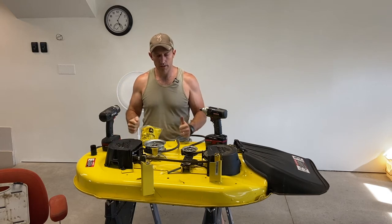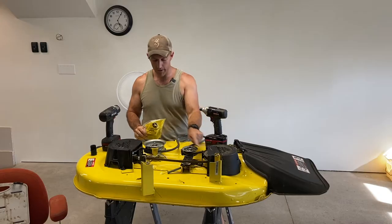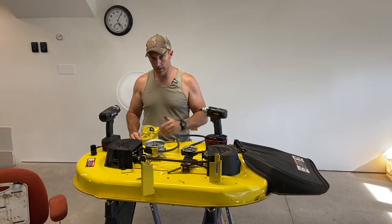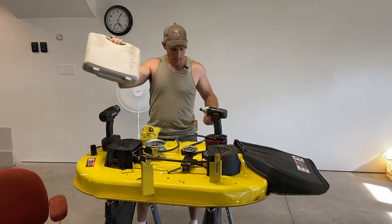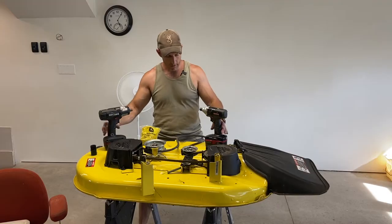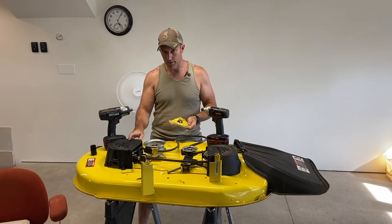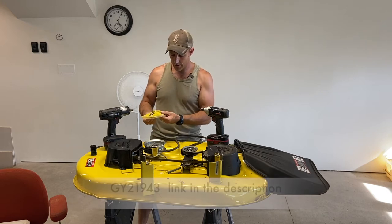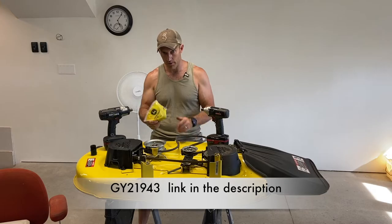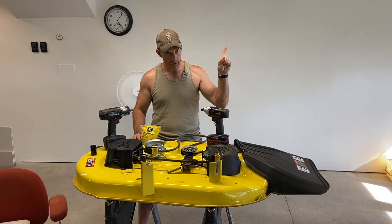In this video I'm gonna be replacing my blade brakes on my 42-inch deck for the John Deere 100 series. I have two brakes, one of mine is worn out. You're gonna need at least a set of sockets — I have an impact wrench and an impact drill. The part number on this blade brake is GY21943, I'll put that in the description. If you don't have your deck off already and aren't sure how to do that, watch that video first.